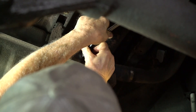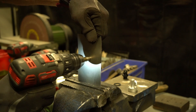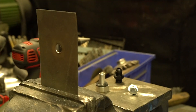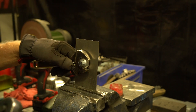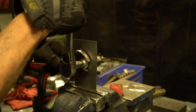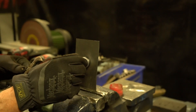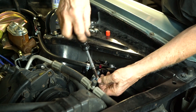Start by drilling a small pilot hole into the top corner section of the fuel tank. Then move to a step drill. Apply some grease to the step drill and drill your hole out to a half an inch. Insert your return bung with the gasket at the base and the bolt on the outside. Using a one-inch open-end wrench, hold the return bung into place while tightening the bolt on the top with a 9/16 wrench. Keep tightening until the bung is snug against the fuel tank, and then you can remove the bolt. Once the bolt is removed, install the AN-6 male fitting as your return line fitting point. Finally, install the return line onto the return line fitting and tighten it.